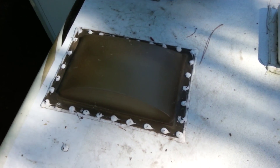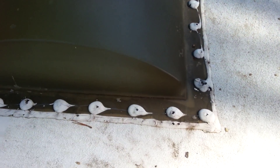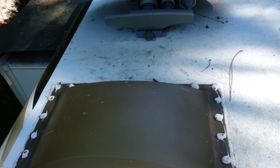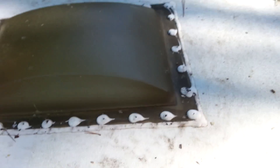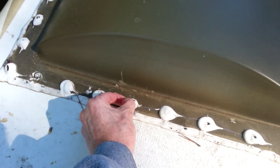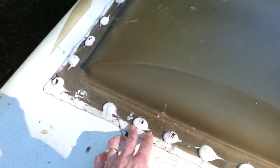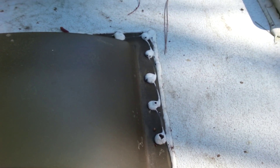Today's little project is cleaning up and repairing some of this old DICOR self-leveling sealant. This is on a 2012 Class A by a friend of ours down here at Fort Wilderness. And you can see already, just since 2012, look how the screws are already exposed. So that will be leaking before you know it. There's a screw head right there, so I'll peel all the stuff off and redo it, to keep her from having any roof leaks.